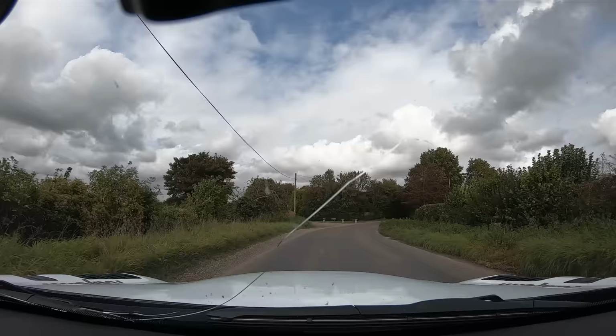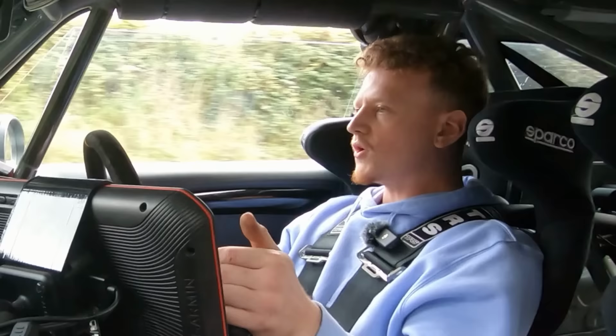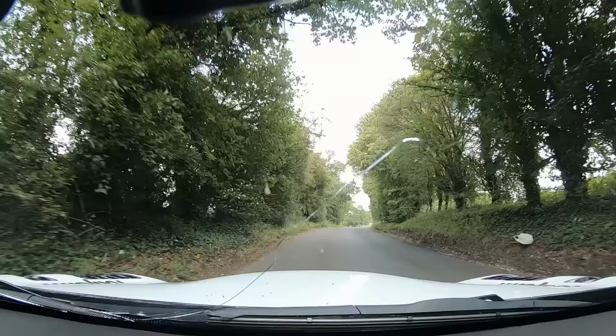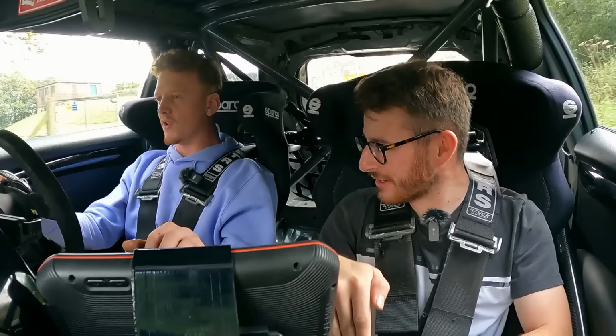Flipping hell. That's nuts. In terms of underbody bracing and any other roll bars, I presume that's all been done. Yeah, so we've got no front anti-roll bar at all. It's been removed for weight, and it allows for a lot more front compliance. Which is why you'll see me tripoding around tracks, where the front dips and the rear wheel just pops up.